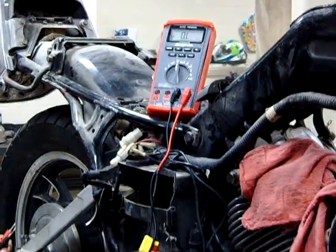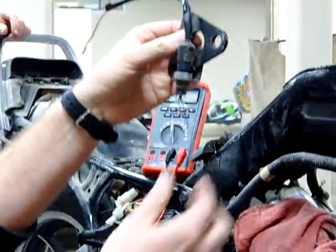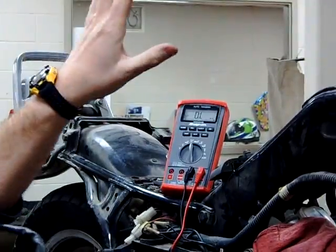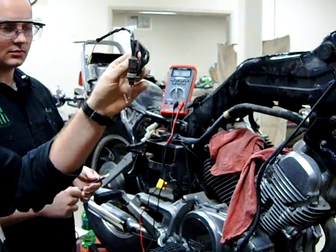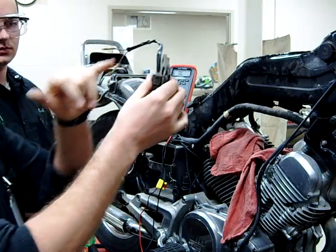You're not going to be able to see what we're doing right here. We're actually going to test the brake switch — this is what would tell your brake light to turn on. Here's one that's off a motorcycle so you can get an idea of what's going on. You remember in class we talked about this — we're either dealing with control circuits or we're dealing with grounds. A lot of you guys are getting focused on the ground wire of this switch, and that's not what we have going on. We're interrupting the power side of this.